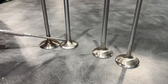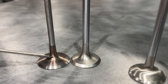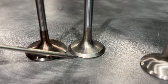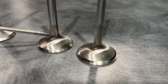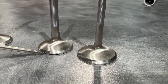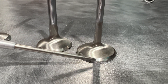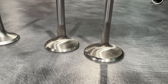Here you've got the OEM valve, which has kind of a nail head on the backside of it. This is the exhaust and here is the intake. When we're talking about the backside and the margin — the margin is what takes heat out of the valve, and the backside of the valve is actually what makes it flow well. Over on the GSC, you can see it has a really nice tulip and more margin. The margin is going to help it flow better and get heat out of the valve. The intake side is pretty close to factory, so I don't expect anything spectacular there. It does have a back cut, which the OEM does not, which has certainly helped flow — but let's check it out.